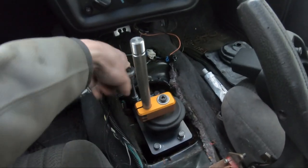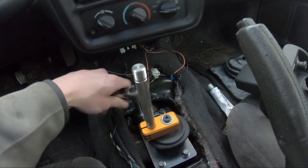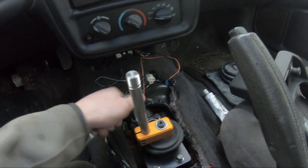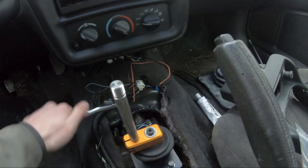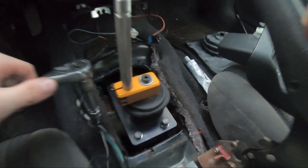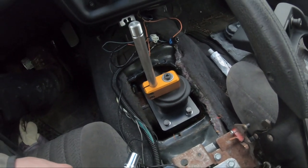Alright guys, so I got the MGW in here and I'm just tightening down the last four bolts now. I just wanted to make sure you guys know — if you're going to do this, be careful with these threads. I've seen people with this exact transmission rip out threads on these; I think they're cast aluminum and that's probably why. So just be really careful not to over-tighten it. There's a washer and then a lock washer, so they don't need to be super deadly tight — they'll hold because of the lock washer. Just get it snug and then back off.